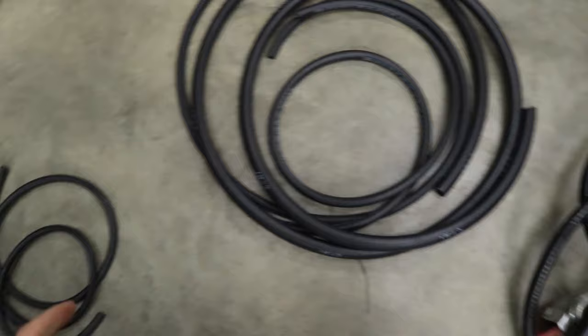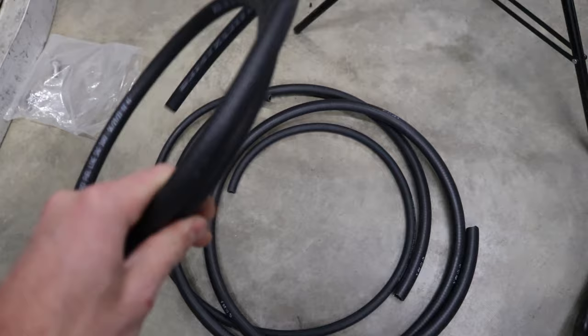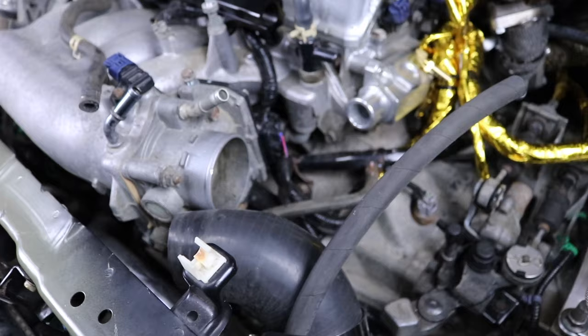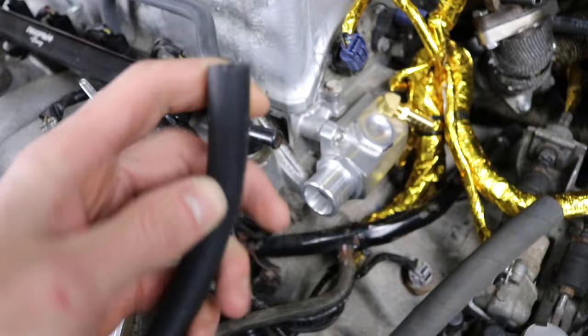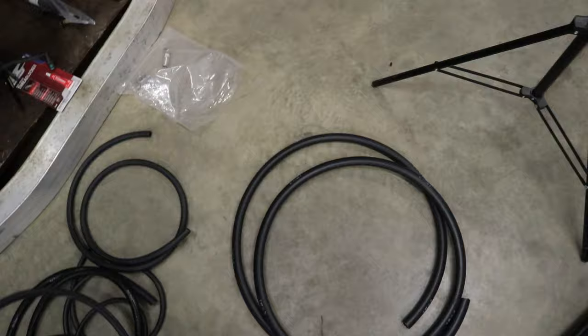So we got quarter inch fuel emissions hose, and then we got a whole pile of hose on the ground. We got our 3/8 silicone line from Bull Boost. I went over to our local hose and fitting shop and got some more 3/8 line — this is fuel emissions line, this is going to be for our EVAP line so we can retain our factory purge valve. The silicone line is going to be for coolant. Then we got some 5/16 heater hose to retain the factory coolant lines and run to the throttle body. I'm also going to replace this line right here that's 5/16, just because there's going to be a lot of heat here from being boosted.